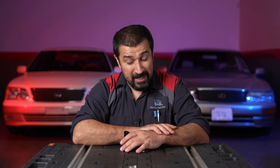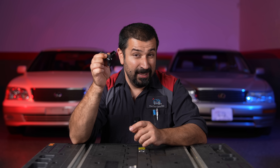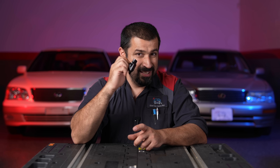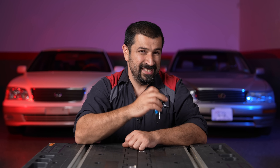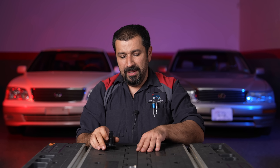This is a very simple diagnostic method. You should never just go and replace a mass airflow without testing it first. Another thing to check is the intake temperature: check the car cold and verify that what the sensor reads matches the ambient temperature before you start the car. If it matches, the temperature sensor side is good. This sensor could also cause issues but is not known to be a common failure point.